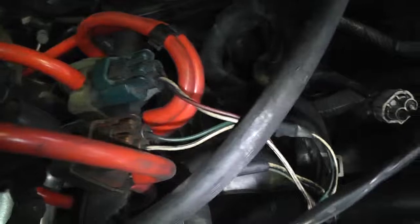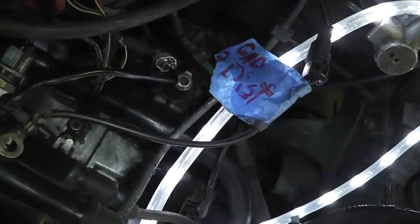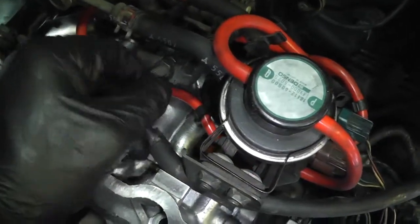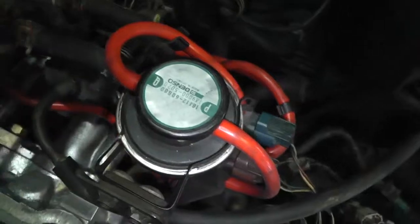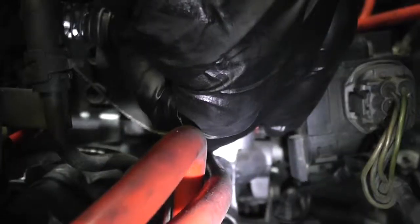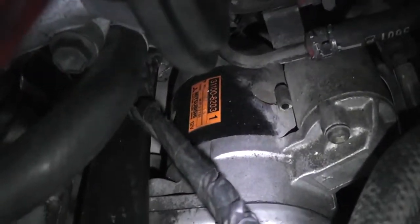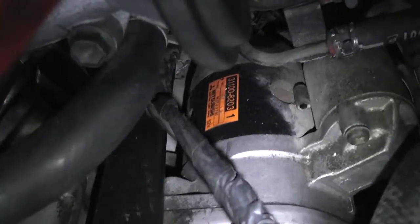I just don't see much, but I did run the throttle cable. I ran it under, I think that's right. I don't think it goes over, I think it goes under because it has this weird bend in it. I just slid that in, that little notch there, and then finger tight, tighten this guy. I'm gonna obviously need to tighten it. And then you've got the little bicycle shifter cable looking thing. I'm gonna loosen this nut so I can push the whole deal. Ooh, camera was balancing on it. Okay, I'm gonna do that so I can slip it out of there.